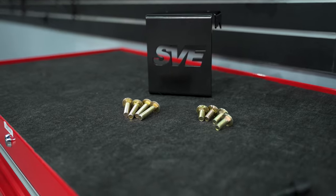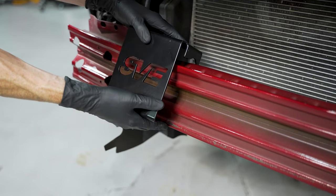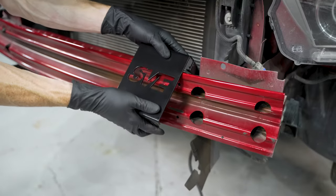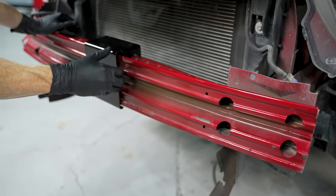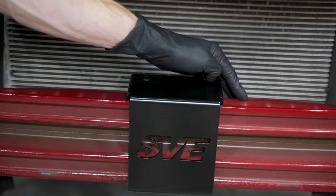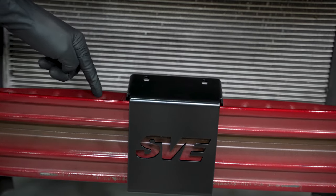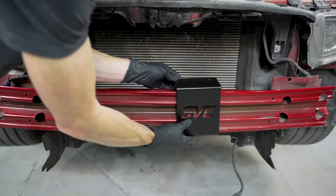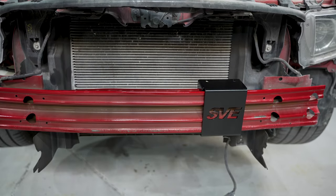Just go ahead and install the longer bolts through the front bracket. With the SVE logo positioned so it's legible, install the front bracket over the crash bar and swing it down. Because of the crash bar design, you can only install the front bracket on the passenger or driver side of the crash bar, then place it where you like. We're centering ours using the dimpling in the crash bar. On some cars a center rib will require you to slightly offset the tow hook to either side.